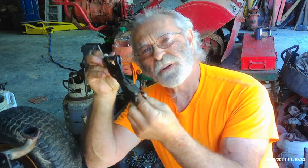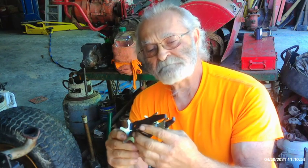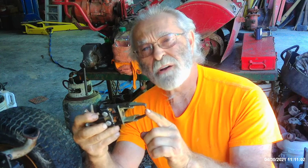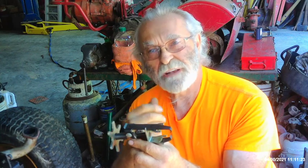So then you go to your old standard, tried and true small engine tool. You stick this in on your springs, twist this, and it'll compress the spring. You pull your keepers out, release it, and take the whole thing apart. This one won't work because the thickness of the tool is too wide to fit in the coils of the spring. This other small engine tool — you can see how it's offset, because as the springs spiral, they change elevation, so there's a slight offset to latch onto the spring equally. As you compress or turn this down, the inner portion pushes down on the top of the valve spring and that flat little bonnet. These are going to pull up on the spring, and as you continue tightening it down, it'll release your keepers — pull them out with a magnet, release, and you're good to go. That one might work on this particular one.